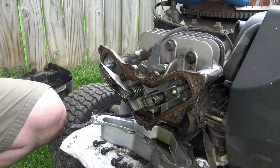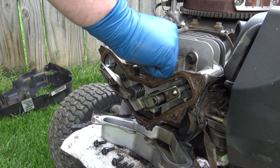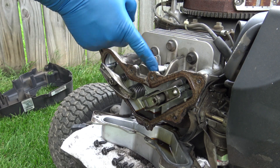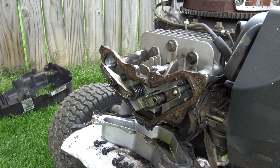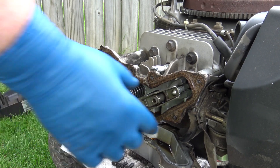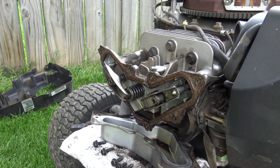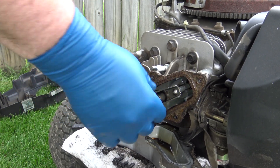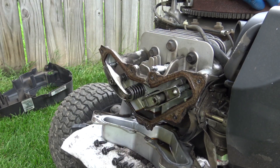There's one more important thing: you need to take the ignition wire off because this engine is self-igniting. If you spin the flywheel it might ignite, so we're going to take that off. We have to turn the flywheel so that the ignition magnet and the coil line up. When that comes together at this spot, you will see that both rockers are loose, and that's the point where we want to adjust them.